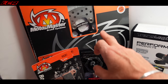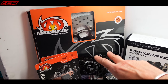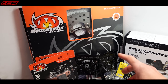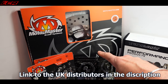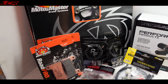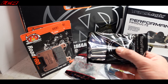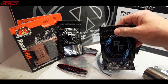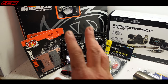First of all, the main issue is the brakes. I've bit the bullet and got some new brake discs — I've gone for Motomaster brakes. I've got these on the SMCR and I've been really impressed with Motomaster in the past. They actually race in BSB with riders on their brakes, and they don't just do supermoto — they do road bike brakes as well. I think the discs are warped, so I'm going to change them. New pads to go with the discs, and we've also got new titanium bolts from Race Fasteners. I can't put on new discs without replacing the titanium bolts — that's my bit of extravagance for the front end. Hopefully that will sort out my braking issues.